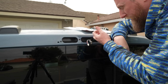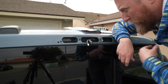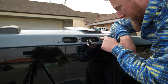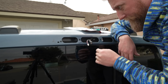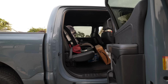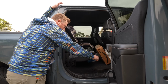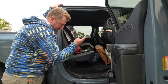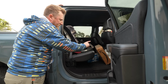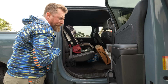We're going to have to drop a bit of the headliner inside the cab to make this all work. So we're going to go take a look at that now before we get to actually mounting up the bracket, which needs to actually screw into the body of the vehicle. Not for the faint of heart on this part, but let's go find a spot for that antenna wire. That means we're likely going to have to come in from the C-pillar along the kick plate and then up and under the front seat. At least that's what my mind is telling me. The advantage too of having the cable underneath one of the front seats is that I can then add a speaker to it to add some better audio in the future.